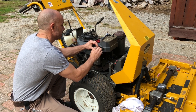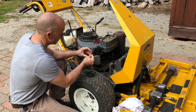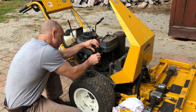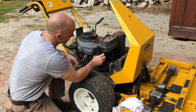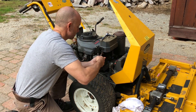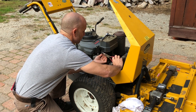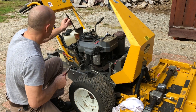Having a little issue with the fuel pump on my mower. She's a little old, still works well. You can see the fuel pump is a little wet, spurting fuel out that hole. Makes it get a little air bound, makes her hesitate. We'll swap that out and see how she runs.